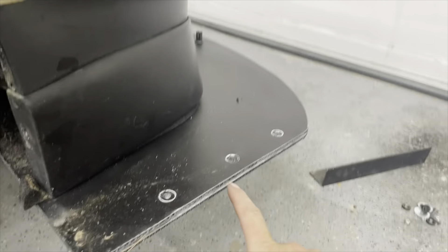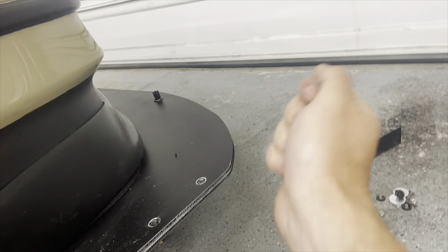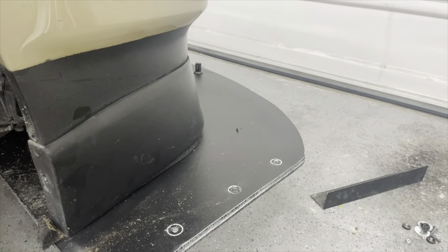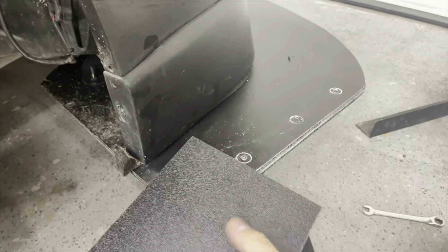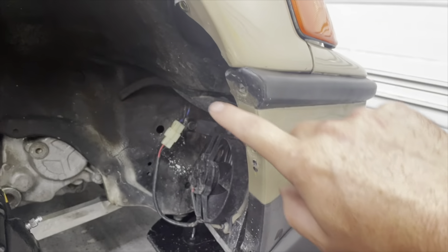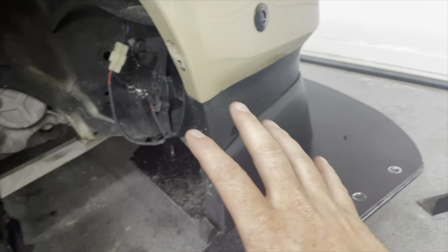Wheel's off — let me show you the thought process. My buddy Matt came over and we came up with the idea together. I've got quick disconnects on my bumper on both sides, and I wanted to retain that. I'd just pull the pin on the two splitter rods and pop these two buttons to pull the bumper off. The only extra step was removing one end plate because the old tire spat wouldn't let me flex the bumper enough. Realistically: two button pushes, pull a quick pin, zap out three Allen bolts, drop the end plate, and the bumper's off — maybe a minute.